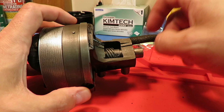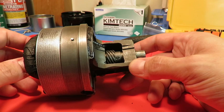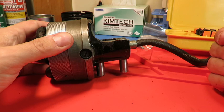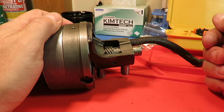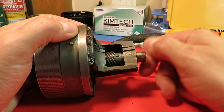As most people say, oil for points of friction and grease for gears, and so this worm gear and the gear that it engages within the workings of the actual machine need grease. And there is already lubricant in here. I'm not going to comment on what I used because I think it's really up to you what you use for this purpose. But I think I'm typically a Tri-Flow kind of person with the Teflon and the grease to go on the gears. Although the old Singer literature says the Singer motor lubricant that you'd use in here is just as good for the gear.